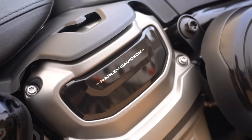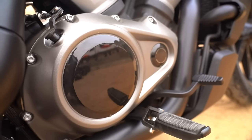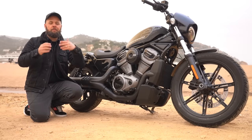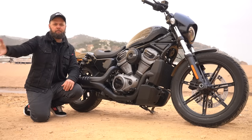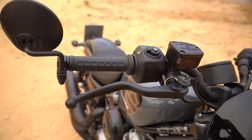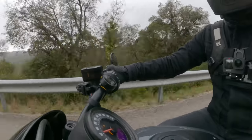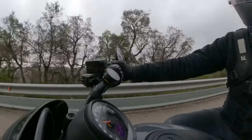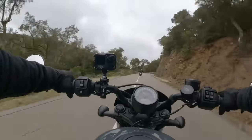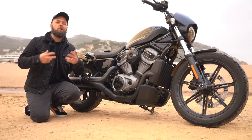Other people might prefer a bit of shake and grunt — it's definitely a bit less characterful and distinctive — but personally, especially on the sorts of roads we've been on today, I'd take the peak power. The only thing I didn't get on so well with is the throttle. It's fine when the revs are up and you're pushing the bike a little bit harder, but in the lower gears and in low speed corners and when you're maneuvering around town, it's just a little bit choppy. It's quite a soft delivery and so I've had it in Sport mode to liven it up, but then when you go from a closed throttle to just cracking it open, there's quite a pronounced lag and then it kicks in and jolts. So if you're trying to be smooth or just getting on the gas to settle the bike mid-corner, you'd want it just to ease into it a little bit more. But that aside, I'm pretty impressed with the engine — it really is a lot more sporty and it rewards you more for that quicker riding.